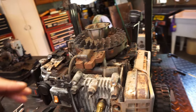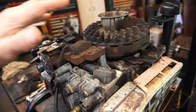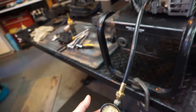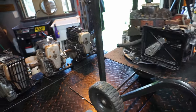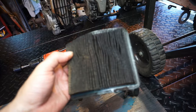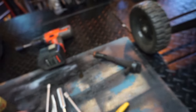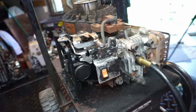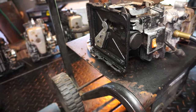This is the original motor, and I want to point out it's got a heavier flywheel - it would have to, so even if we found another motor we'd need this flywheel. It needs it because there's no blade on it. It makes 75 pounds compression. The plug was loose. The dipstick is leaking, which is common - they wear. The air cleaner is saturated with oil and muck. It might need a valve job - it makes 75 pounds and may just need a valve job.